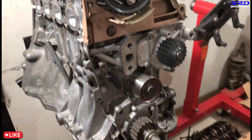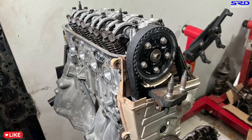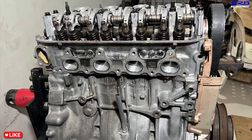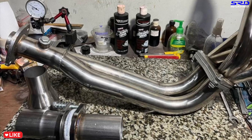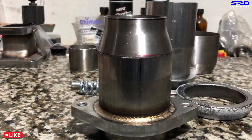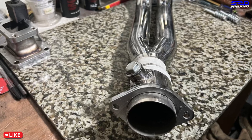AEM cam gear and blueprinted oil pump - this is going to be a really stout engine. Next we need to port-match the PO8 intake manifold onto a B16 throttle body, which is what the owner will run. He runs a generic 4-to-1 header, and because his business works with stainless, he modified it himself - same mod we do on the collector, making it 2.5 inches. His hatchback runs a D13B with this exact same header and a full 2.5-inch exhaust on a Tanabe or Apexi muffler.